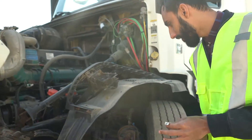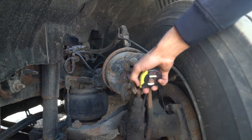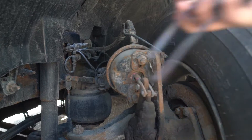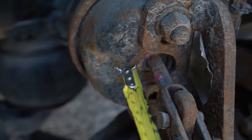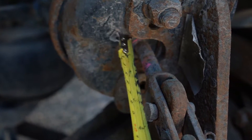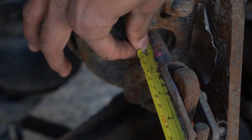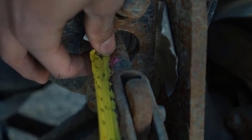When the stick was in, this marker was at the back. Now it came to the front. We're going to see how far it came out. We're going to measure how far this mark came from the back to the front. It came out roughly around one inch, which is good. We marked our push rod — it came out roughly one inch, which is good. If it was more than two inches, it would be a major defect.